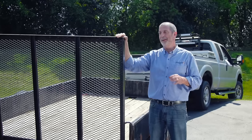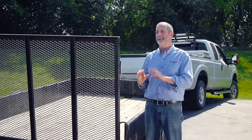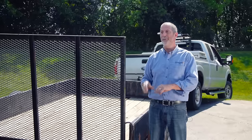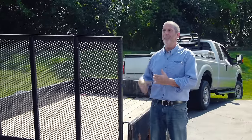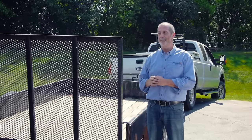Through this video we've shown you a number of different ways to ground and secure your trailer lights. There are a number of odd situations that can cause grounding problems. For example, if you have a foldable trailer, you have to have it fully extended so you have continuity of a ground. Other issues can come up with composite or homemade trailers — if the trailer isn't made out of metal, you won't get a solid ground. Last but not least, if you use existing bolts rather than drilling, the coating on the bolt or nut can also resist the ground and cause problems. Hopefully this video has given you some insight and ideas to make sure your trailer light install is successful.